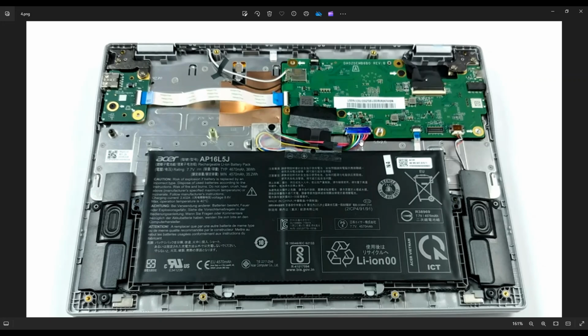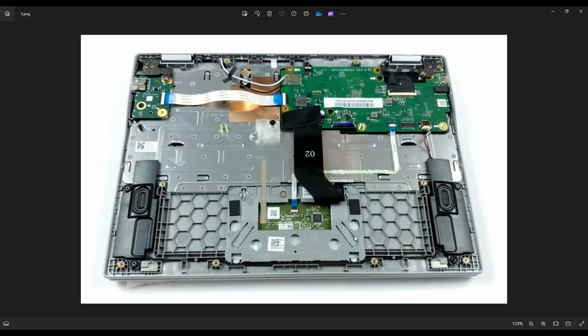Also, what's a pain about this is these wires interweave through this ridiculous thing here. So you may have to peel this off of the battery, peel this black tape up from there. It's kind of a messy pain to get that up. Okay, so now that the battery has been removed, it's safer to proceed more into the computer.